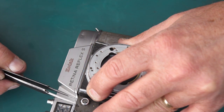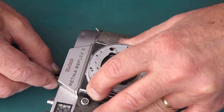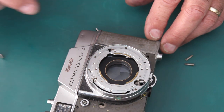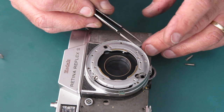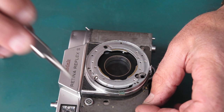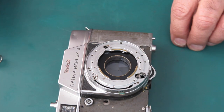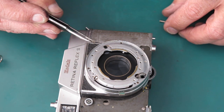I've still got probably six millimeters — a quarter of an inch gap at the top. I need to move the mirror down, push the mirror down, and then lower this into place. If you don't do that the mirror will be trapped on the wrong side and nothing good will happen. I can put two of the original screws in at the base here, and all this depends on those cleverly stacked washers not tipping over so that everything stays in place.